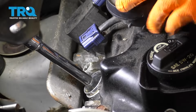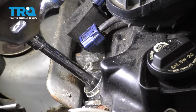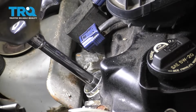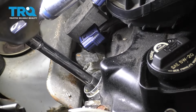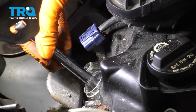It's bottomed out. Just going to double check it with the ratchet. Yep. All right, let's get the torque wrench. 13 foot-pounds. You basically just want to crush that gasket that's at the top of the threads. All right, there we go. It's important that you make these properly tight because this engine is known for blowing out spark plugs.